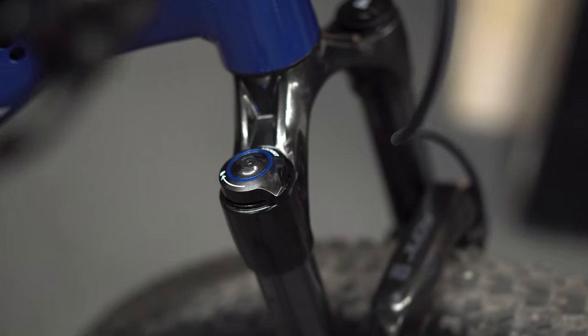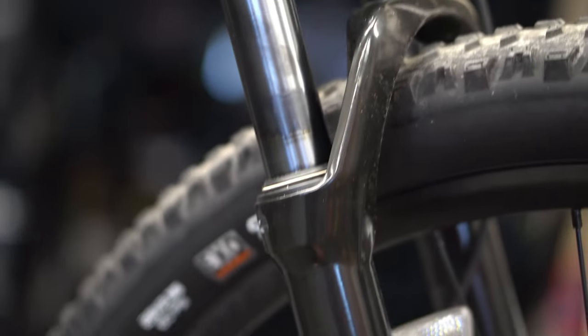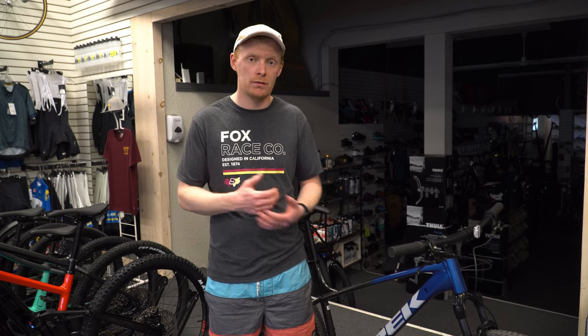Features this one specifically has which are significantly better than the last: compared to the Trek Marlin 7, you go from a spring fork to air. Air is much easier to tune and easier to set to your own body weight, whereas a spring is more general purpose — if you're too heavy you'll compress it more, too light and it'll be stiff. With air, you'll get good performance and it's relatively easy to maintain. All you need is a shock pump; the recommended settings are printed right on the front fork, or you can look them up on Trek's suspension setup page. Air is also typically a bit lighter than a spring fork.